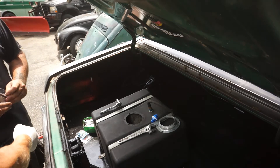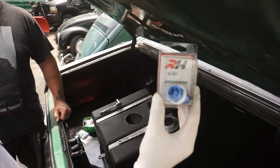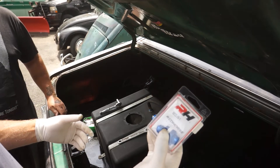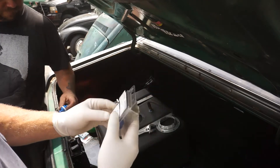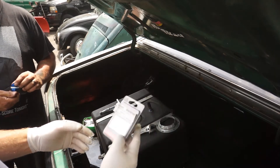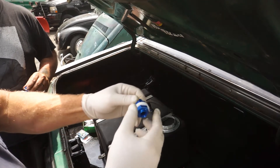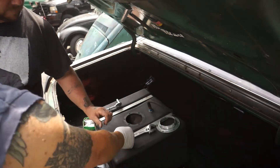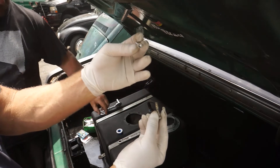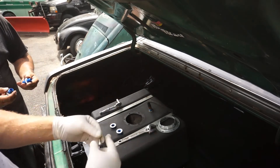We're back from the store. The guy up in town didn't have just the gaskets - you had to buy the whole thing. So we got this Red Horse, it's an 8832-08-1, about 10 to 12 dollars. He prices everything off Summit and charges a little markup. It comes brand new with a new nut, new fitting, new washers, and gaskets. We also went ahead and bought stainless steel allen head bolts instead of the original bolts, so you can put your allen key in there and tighten them up - much easier.